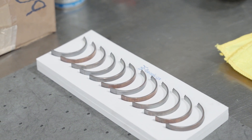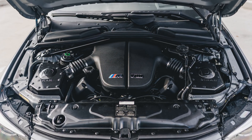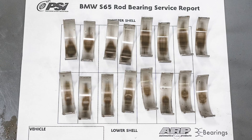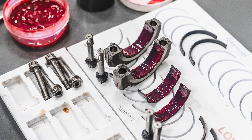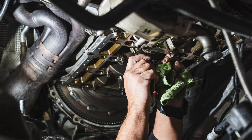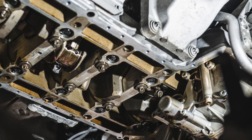There are two main factors that differentiate BE bearings: the design and material, and the clearance. A lot of people want to use factory bearings claiming they've been revised, or coated factory bearings. Some of the newer updated bearings from 2010 on are made from tin and aluminum, which are actually harder on the crank and rod surfaces and don't show traces in Blackstone oil analysis. BE bearings are lead-copper material, which we can track in Blackstone, and they're softer and easier on internal engine components — so less wear. They're also coated and made to a specific clearance that accounts for the 10W-60 oil these engines use and the bearing coating itself.